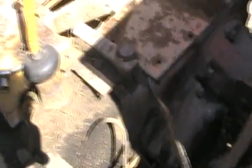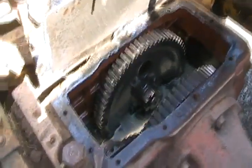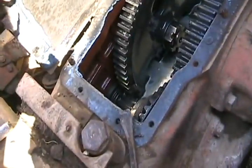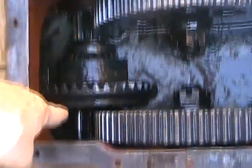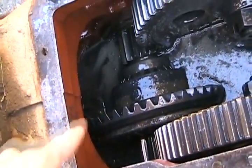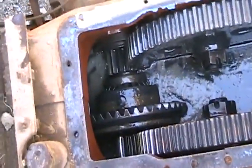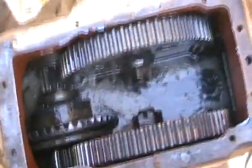Now that the seat's off, let's see if we can get this cover pried up. Let's see what we've got in Pandora's box — some big gears. Well, good news and bad news: these have just been fully rotated a few times around and there are no teeth missing. There's no missing teeth in the little pinion gear that drives the big main gear either. I just checked all the spider gears and all that in there.